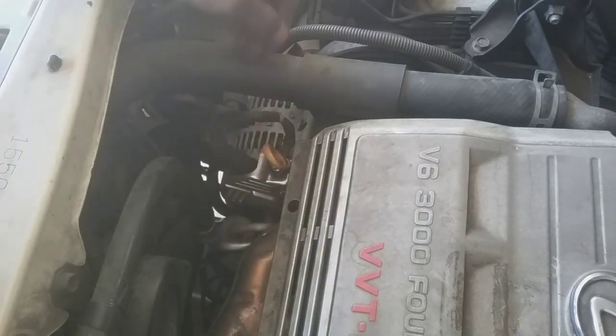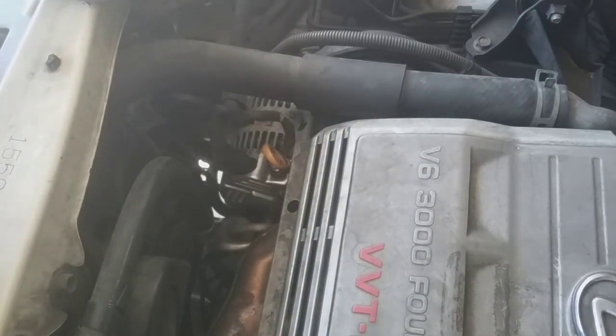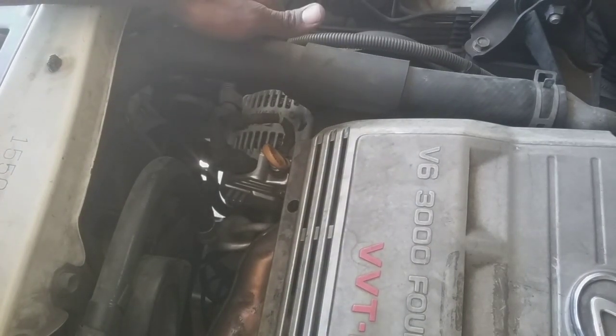It is making, again, a whine noise. I'm going to start it so you can hear it. I did check the voltage really quick. It showed 14 volts and then it suddenly dropped. It begins to heat up, then it starts to emit the odor. So, this is obviously just a bad alternator. It was a remanufactured one that's currently on here. I'm not sure where it came from, but calling my parts store, it didn't come from us.